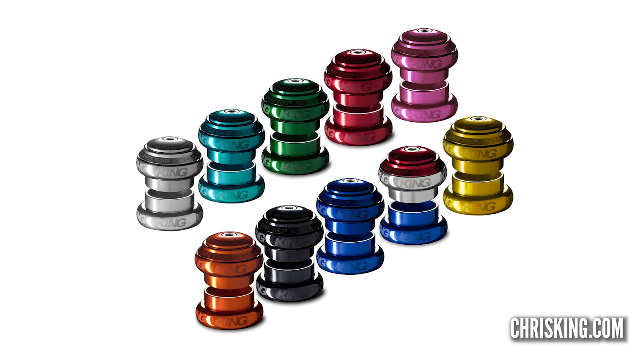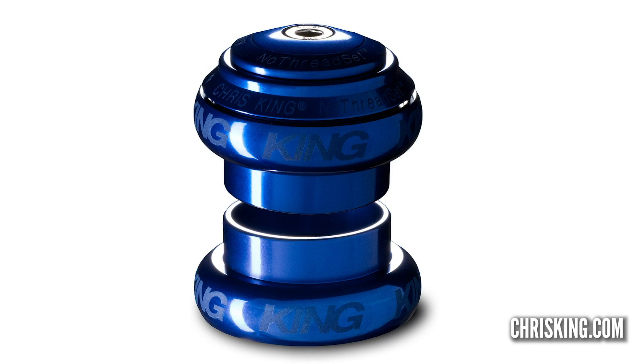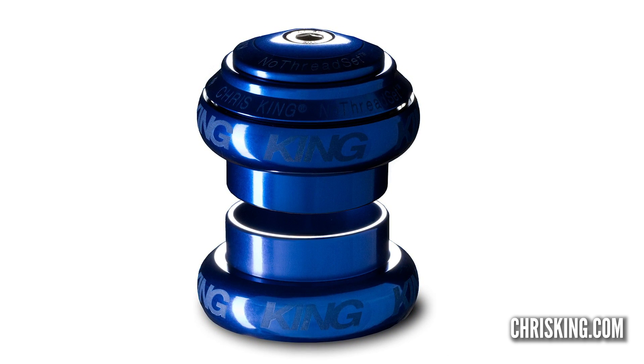So your options are: get a new headset, or simply get some new bearings and do an overhaul with some really good quality grease. I'd be inclined to go that way — there's no real need to change it unless you've got a burning desire to buy a brand new headset. If you do want a new headset, definitely consider something with a really substantial warranty, because it's one of those parts you'll be reluctant to touch until it breaks. I've never actually owned a Chris King headset, but if I was going to buy one tomorrow, it probably would be a Chris King — mainly because of their warranties and the bearings themselves, which can be rebuilt. They're notorious for their quality; it's pretty much a buy-once affair.